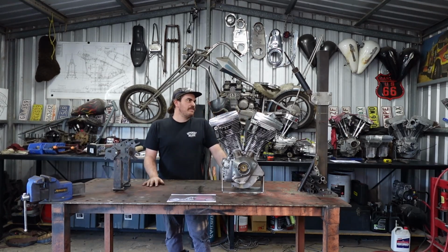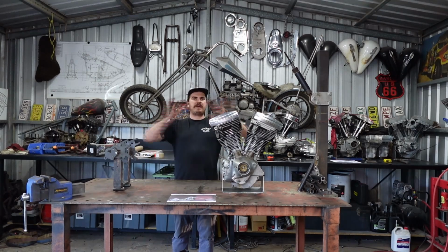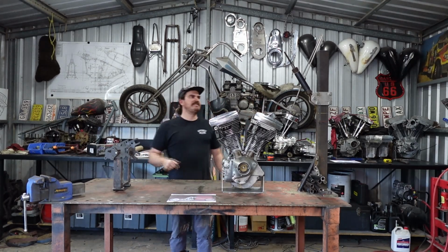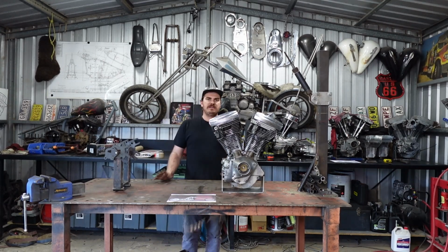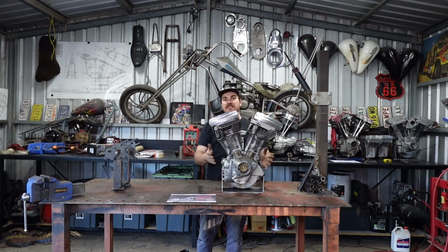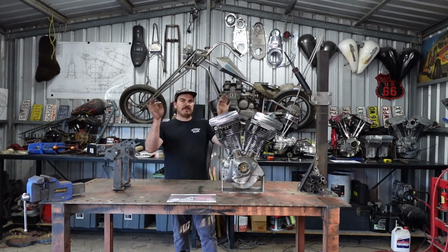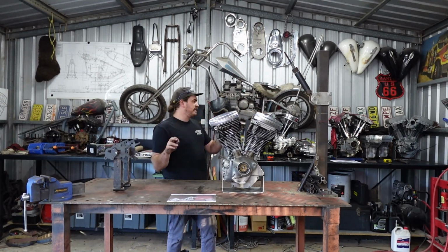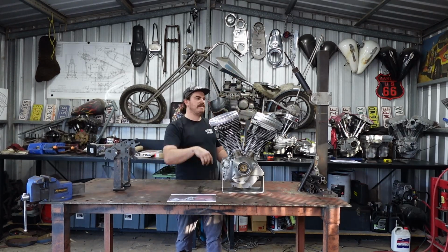What I want to do now is, I've got some butcher's paper and I want to draw this frame. So I'm going to set the butcher's paper up here somewhere, stand back where you are, and draw this frame where I want it. The beauty of having the butcher's paper behind here is I can mark in all the axle plates, where the engine's going to be, and where the neck's going to be. Then I'm going to bend a bit of TIG wire or something else to get the right radius and draw the radius in.